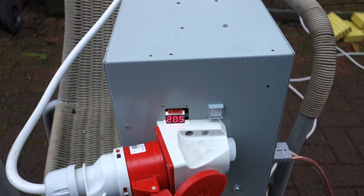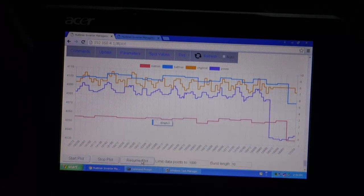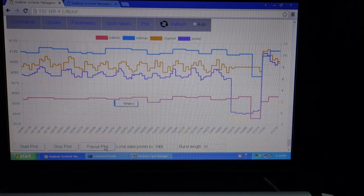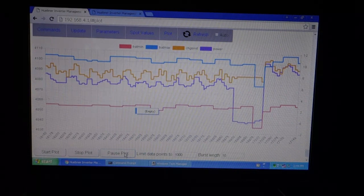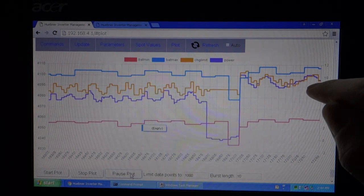What you see here on top of this current display is a Wi-Fi module, and that connects to my car's ECU via Wi-Fi. The car's ECU connects to the Nissan Leaf BMS via CAN. It ties it all together, and it receives this yellow charge limit from the BMS — I'm sure Nissan have spent a lot of thought in calculating that charge limit. And we will see, as the battery fills up, that it obeys it.